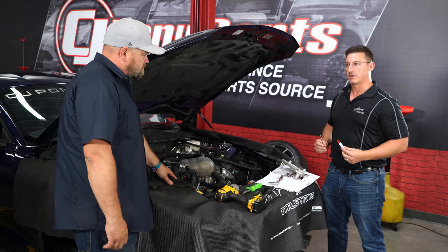The calibration team at Edelbrock will email the tune file. Save it to your desktop, open up Device Updater, and plug in the SCT BDX to your computer. Go to 'Load Custom Tune File,' identify the device, click Browse, locate the file on your desktop, and open it. It will appear in available tunes — transfer it over to 'On Device' and click Program. A status bar shows progress, and when it says 'Custom Tune Programming Complete,' click back, then exit. Unplug the tuner — it's ready to go to the car.